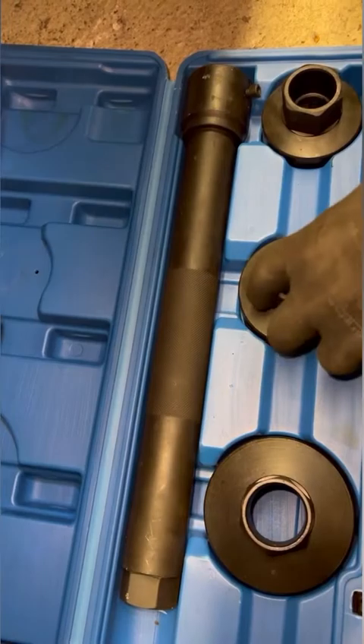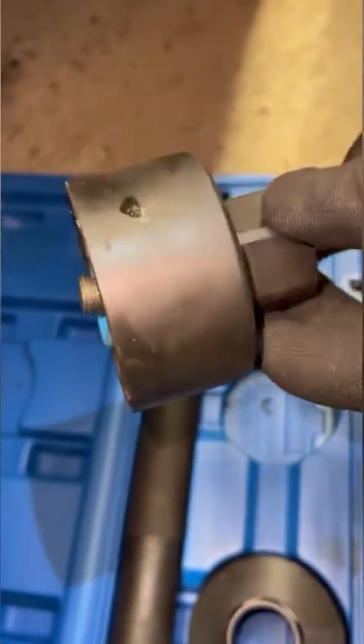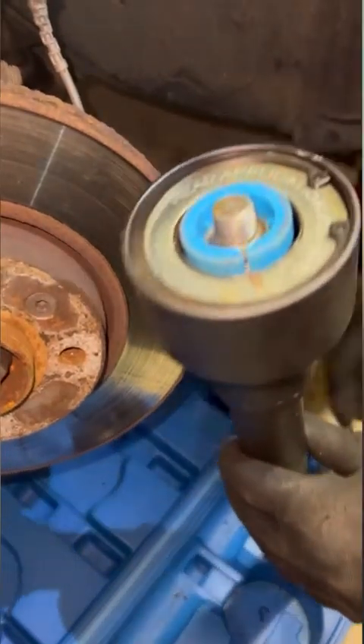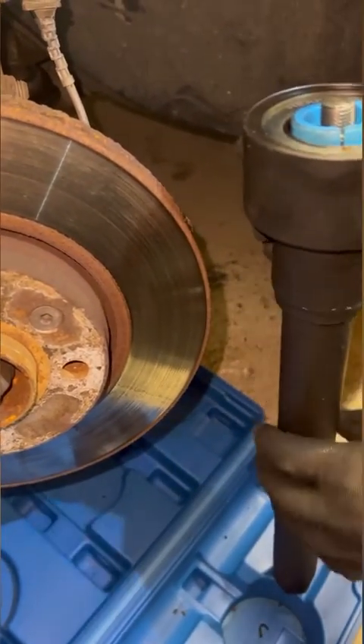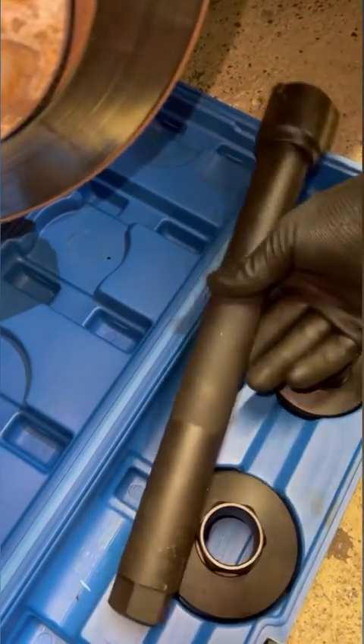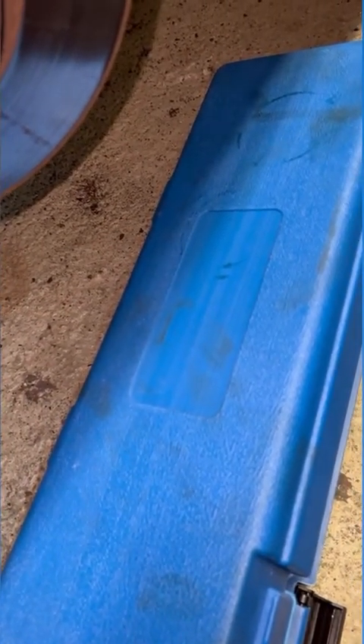This method works on practically any car. When tightening it back up, your track rod end will spin that way and come to the same point where it gets stuck, then you turn it the other way with your breaker bar and it tightens. It goes inside like that. Definitely put it on with a few threads by hand first, then use the tool. All in all, this is a brilliant tool - it's not an expensive brand like Laser or Snap-on, just a standard one, and it's definitely recommended. If this has helped, please like, share and subscribe - thank you.